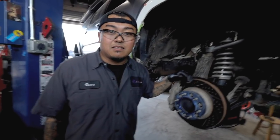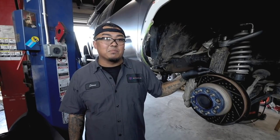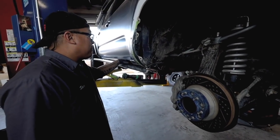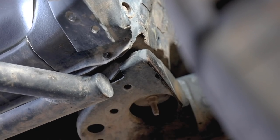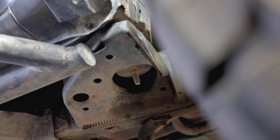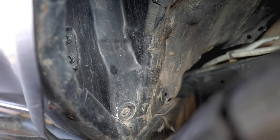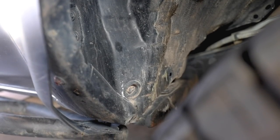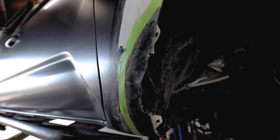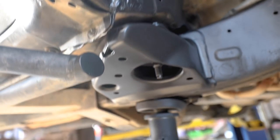What's up you guys, Steve Huntek here. I work here at SSA House in Bellflower. I specialize in body mount chops, cab mount chops, and pinch welds so you guys can fit 35s. We have George's Tacoma here — basically we're just doing a repair cab mount chop. The chop was done maybe about four years ago in a backyard garage, but hey, everyone's on a budget. We're here to make a nice repair, give him more clearance. We're gonna chop up the old cab mount chop, blend it in, clean up all the pinch welds, fix some center damage, chop that off, clean it up, and coat it so there's no rust buildup. Check it out guys — boom, finished product! Look how clean that looks.